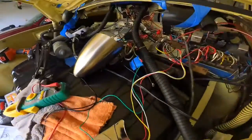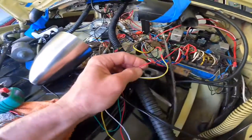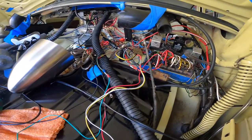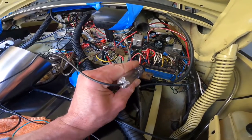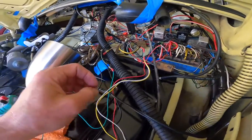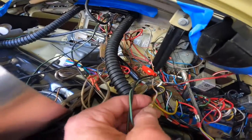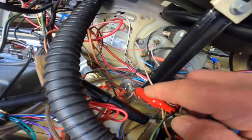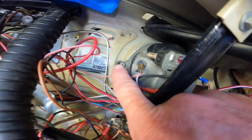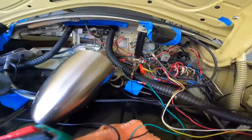This blue-green wire connects to my K3 right here. The red wire is going to a live source — positive 12 volts. You can use a multimeter to measure the power, or you can use a test light. The last wire is the ground wire; you can connect it to any ground surface or ground terminal in your car, which could be a common ground terminal connection like this one right here, or a spare ground connection up in your speedometer. We've connected all the wires — let's go ahead and give it a test run.